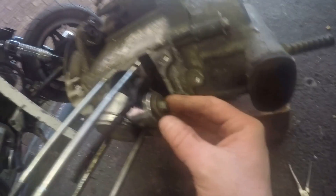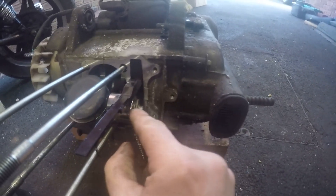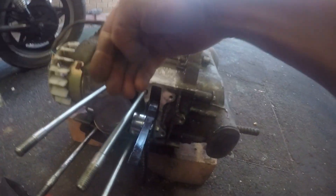What I've used is a 24mm socket - it doesn't really matter as long as it's bigger than the clip - you put the washers on that side, put the bolt through, and then you've got the nut on the other end. As you turn this side it pulls the gudgeon pin through. The problem you have sometimes is it starts to spin. I'll have to put some more washers on this side and just keep pulling it through. They don't actually make a puller for this as far as I know - maybe that's an idea for someone who wants an invention.